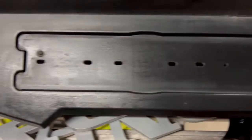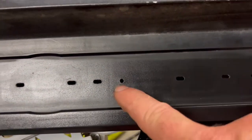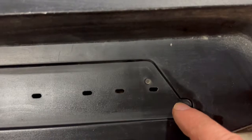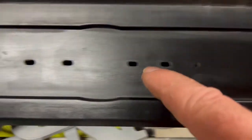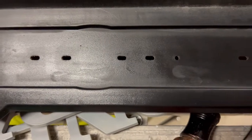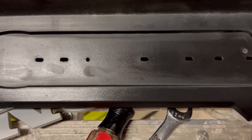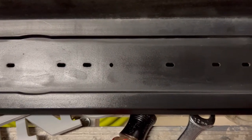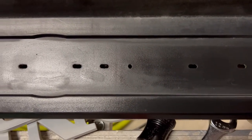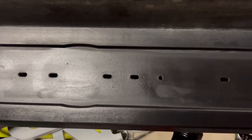From the outside, this is what the rear emblem looks like — a single center hole, four slots on the right, five slots on the left. You do the same as the door: turn it around, put the screws in from the back with no washers. Start with the center one, then get the two opposite ends, then fill in the rest, and snug them all up when they're all in.